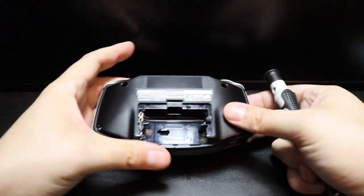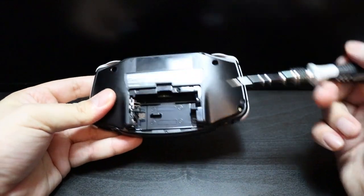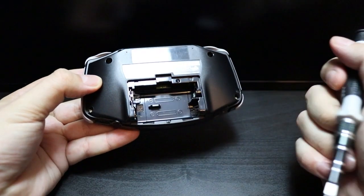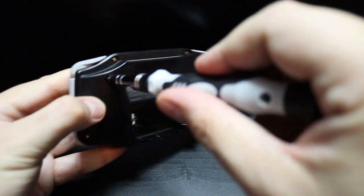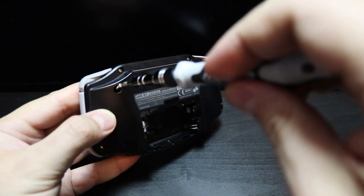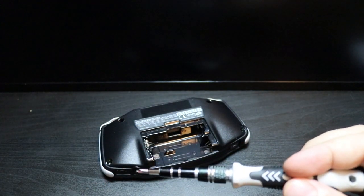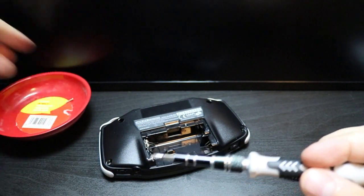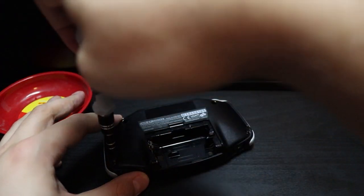So to start off with the screws, we have 6 tri-wing screws here and 1 small Phillips head underneath the battery compartment. So you'll need a tri-wing screwdriver to take these screws out. Now with the kit I bought, it comes with both a tri-wing screwdriver and a small Phillips head screwdriver. So if you don't already have a screwdriver set, they come with this mod kit that I bought. And I will leave a link in the description below of where I bought this mod kit.